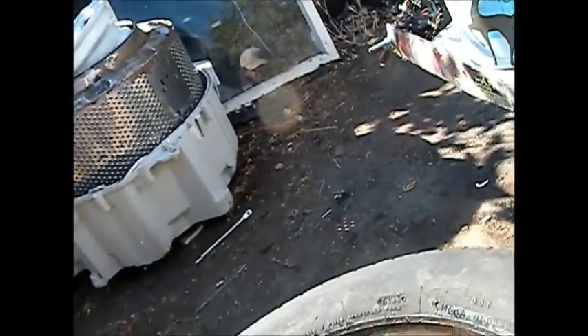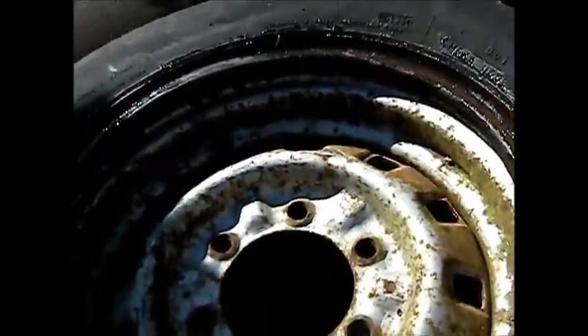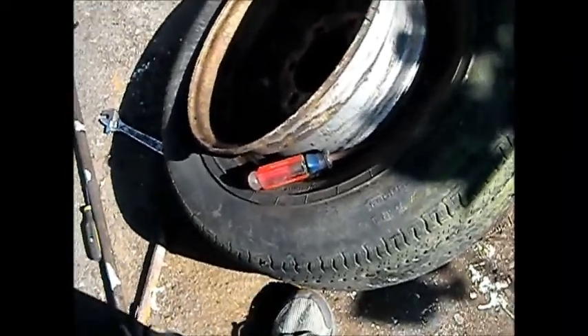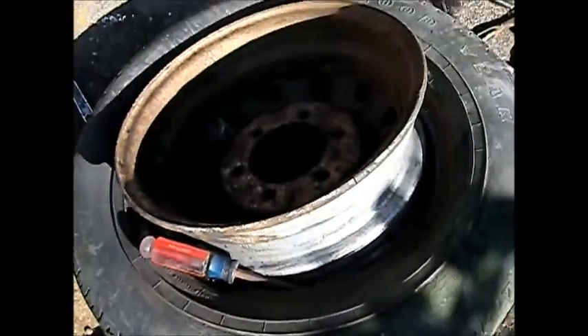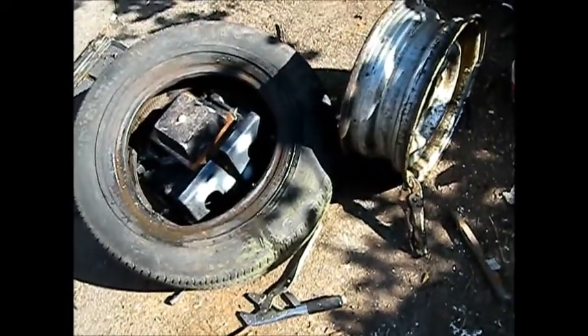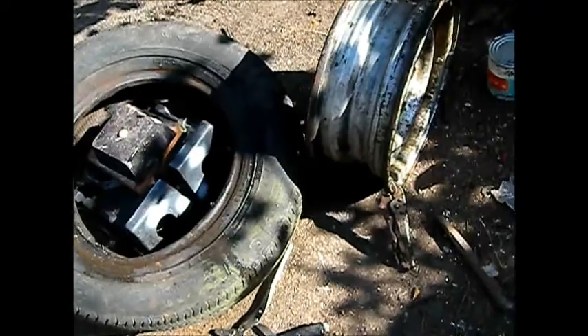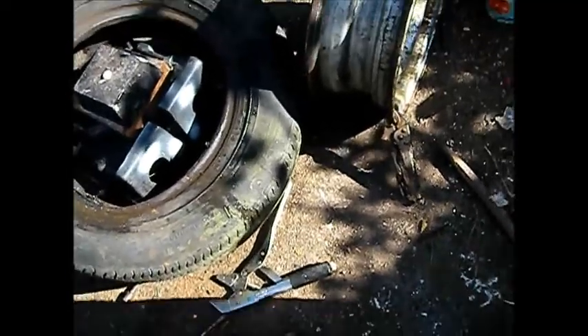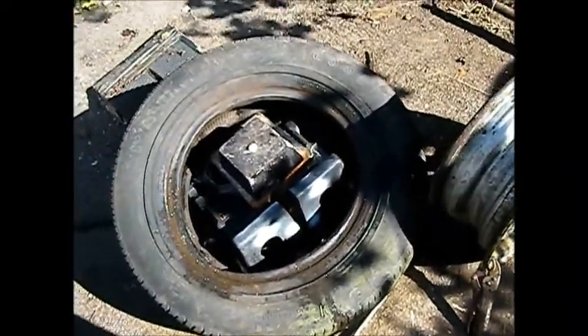In this case, it's out through the front. So we're taking it off to the front, because this side is larger than this side. You want something on your knees so you can put pressure on that rim as you take this off. I have to use both hands and my feet to do this. I got my exercise for today — finally got it off. I put that underneath so it has pressure on the rim to pull out, and I used the vise grips to make sure it didn't back off when I start pulling it off the rim.